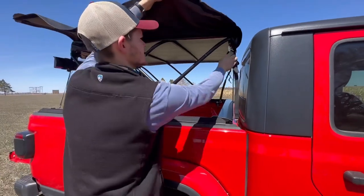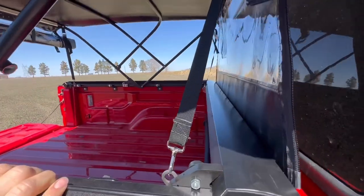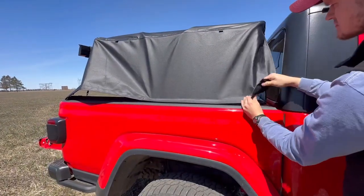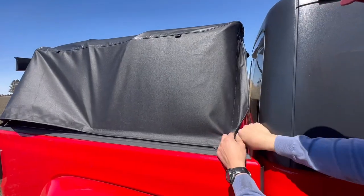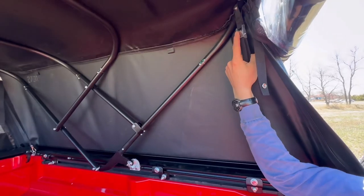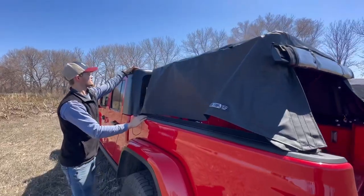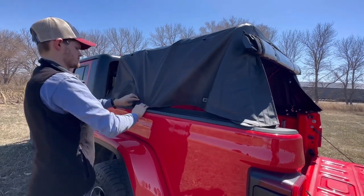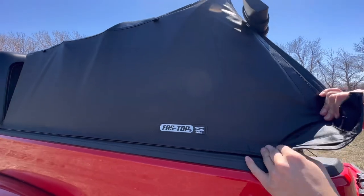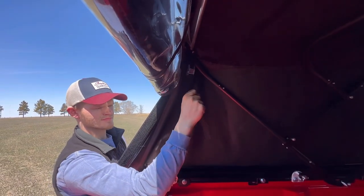The cam buckle straps are an important part of setup. Use the center bolt on your x-frame to help fasten the side sheets. You can reapply tension to the side sheets by pressing the cam lever. Make sure there is even tension on the side sheets and the cam straps. Before making adjustments, make sure the topper is at a similar height to the cab. The cam buckles will help stretch the side sheets to the rails — make sure there is even tension between the cam strap and the side sheet.